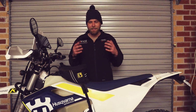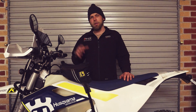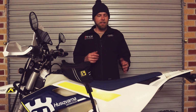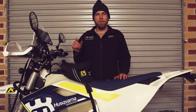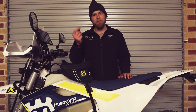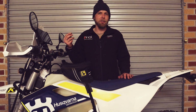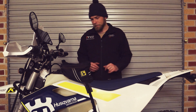Well, thanks for watching this installation, episode 3, putting the bash plate on. There's 3 tips that I can give you when you're installing this Enduro Engineering Extreme skid plate. Number 1, when you're putting the adhesive on, make sure you just skip the original mounting points for the original skid plate. When you put those bolts back in, it really is a bitch when you've covered it. Trust me, I know. You have to get the screwdriver in there and try and find the hole and then try and get the bolt in past the adhesive. It's a pain. Just leave a gap from the beginning.